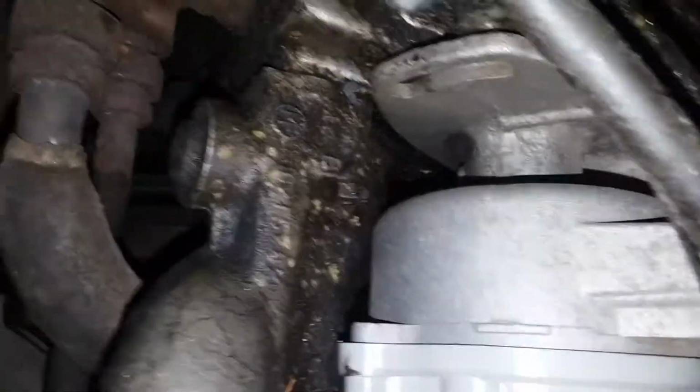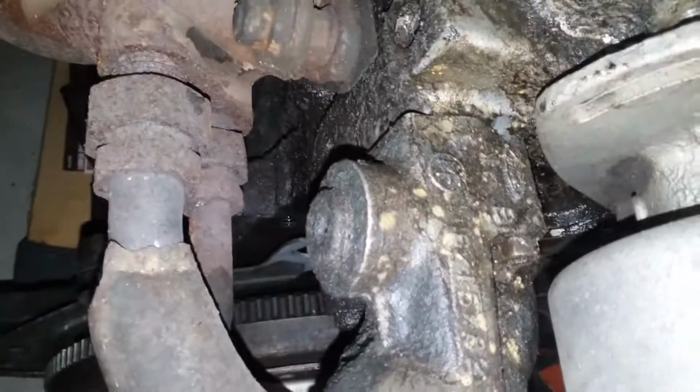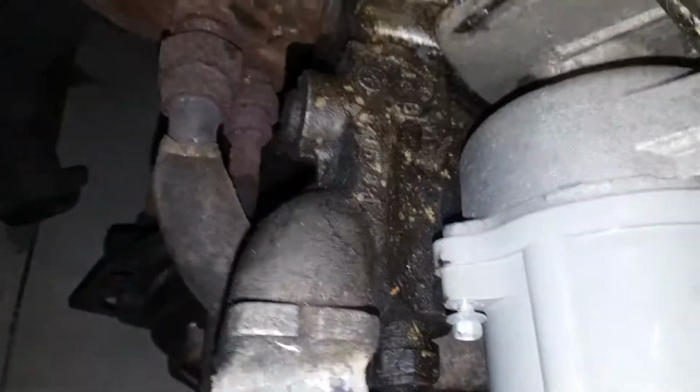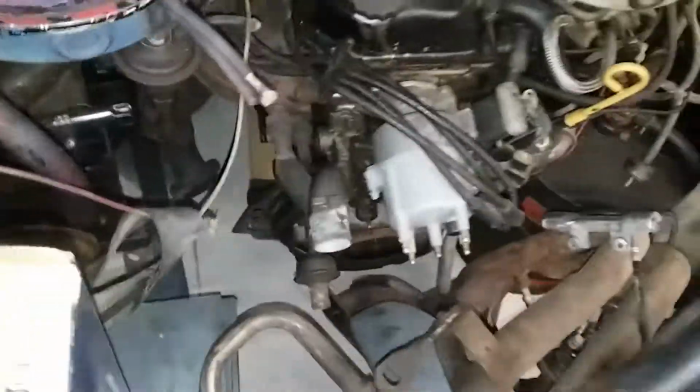And then some of them will also have this Allen head slug on the side. That's a spot where you could potentially put another sensor. I think, yes, unless this is an air bleed, that should be a fine spot to put a sensor. And I think it is the air bleed. So you can't have one there, or maybe you can, but I don't think it will be as effective. But if you put it right where the factory one is, that's perfectly fine.